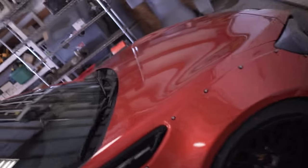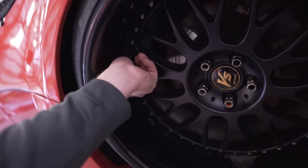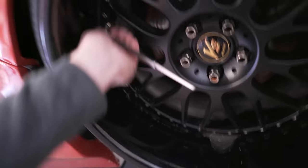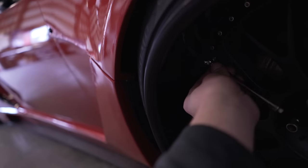Let's pull these wheels off. I'm going to be smart and check tire pressures so I don't pull the wrong wheels off. I'm running about 45 PSI — actually 48, wow. Let's run like 40 PSI in these things. I'd usually run 32 PSI on a normal car, but these tires are so stretched that I want to run a little bit more PSI.